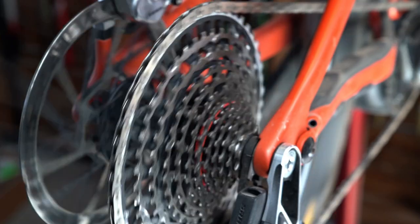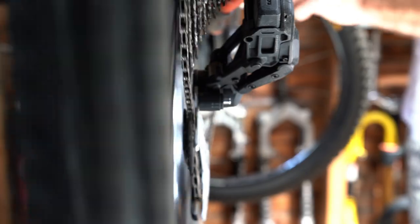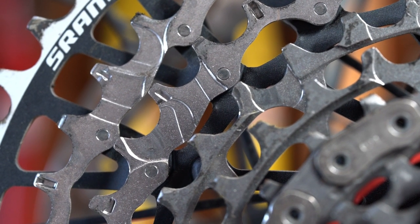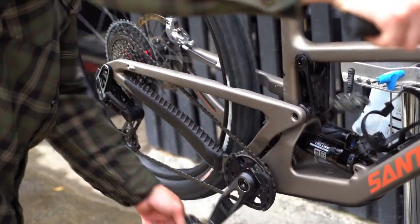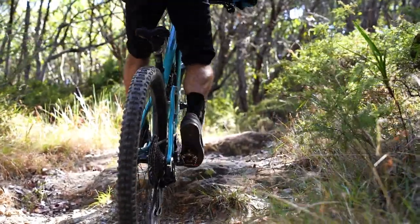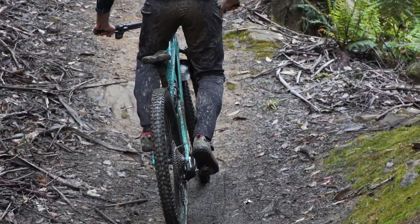The jumps between each gear at the low end of the cassette have also been tightened. This reduces the mechanical gymnastics that the chain has to perform when going up to the larger sprocket, and it results in less disturbance to your cadence. All of the sprockets now use the narrow wide x-sync profile, which improves retention and accuracy by providing a very specific shift gate for the chain to transition through as it moves between each cog. Additionally, if you try and shift three or four gears in one go, the derailleur won't attempt to do all of that in one hit — instead it hesitates slightly, which gives the chain a chance to hit one of those shift gates before changing gear. This means that in the workstand shifting appears slow, but out on the trail the system does this deliberately in order to shift with better accuracy and reliability under load.